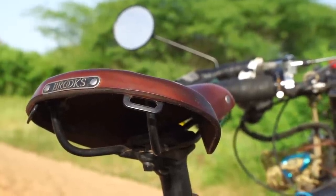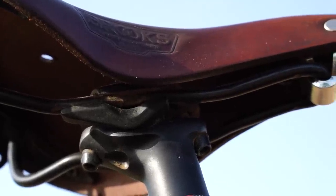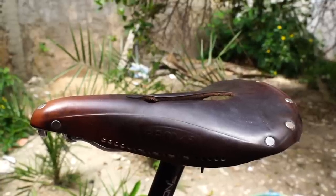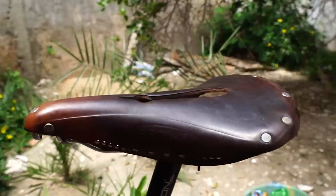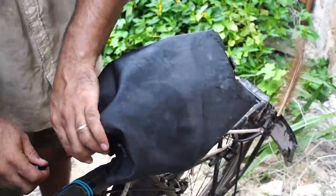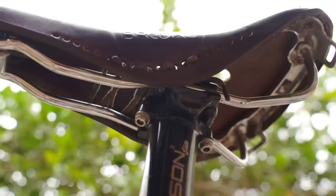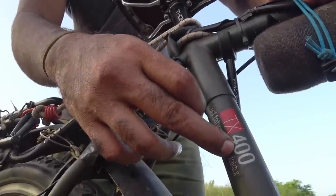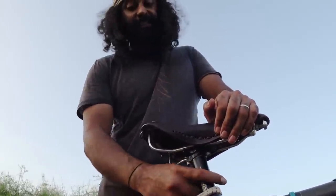We both have Brooks leather saddles. I have the ladies B17 mounted on an Ergotec seat post, which we chose because it has two bolts, making it a little more durable than a one-bolt seat post. My saddle is also a Brooks B17 Imperial — the hole in the middle makes it imperial. This saddle has tension straps and we need to make sure there is always enough tension. So far no problem — they are very durable, the only downside is you need to keep them covered when it rains or overnight if there's condensation. The seat post is a Thomson Elite with two bolts, which is supposed to be very durable and has been. This VSF TX400 frame has a pretty uncommon seat post size and Thomson was the only one making the right size for this frame.